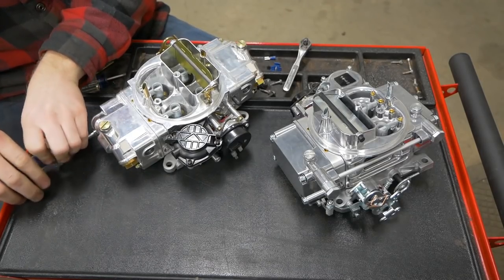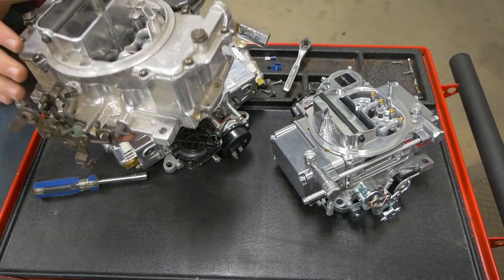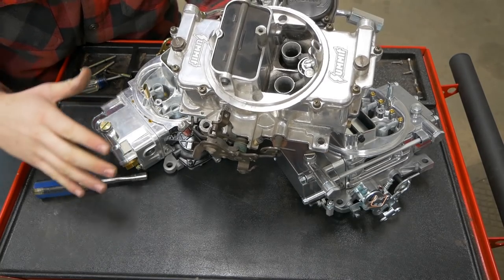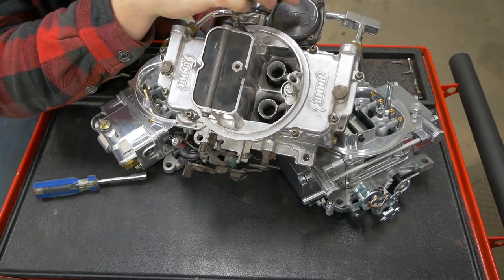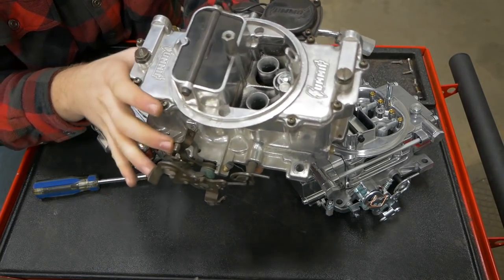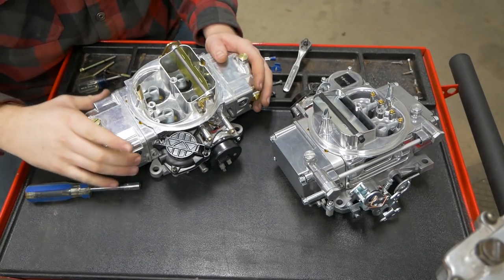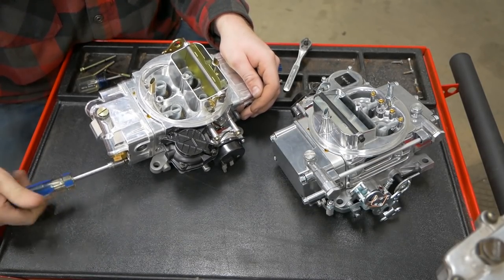This is what's known as a side bowl carburetor. The Summit and Edelbrock style carbs are what's known as a top plate where this whole face comes off. Some people prefer those for accessibility and how easy it is to get them off. On this Holley you have to worry about the choke linkage and this whole fuel rail has to come off just to get to the bowl — which is why these styles of adjustable secondaries are amazing. But I like the Summit style because when you take the top off all your fuel doesn't dump out. On a Holley you pull the bowl off and fuel still in there dumps out on your intake and can eat the paint.